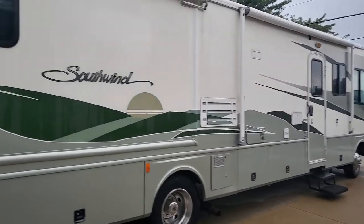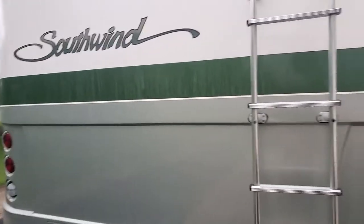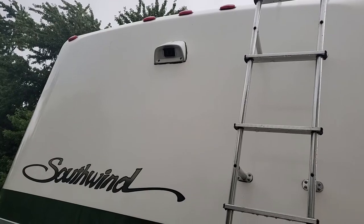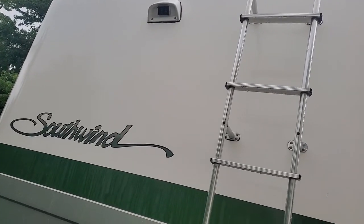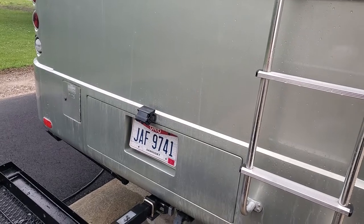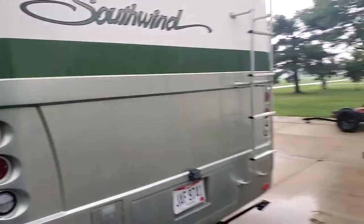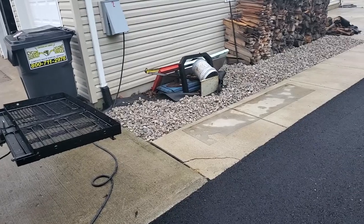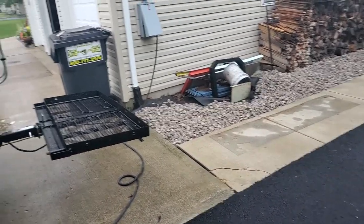Since we're towards the back already, let me take you back here and show you the very back. I got the camera up top replaced — the reason to replace the one up top is that the older style Weldex units have a five-pin S cable running front to back. I changed them to a four-pin, and I added a rear camera at the base for the hitch, because the gap between the top camera and the one viewing the back meant you could only see the hitch and the first crack in the concrete beyond — not enough to attach a trailer.